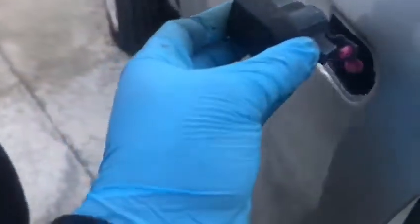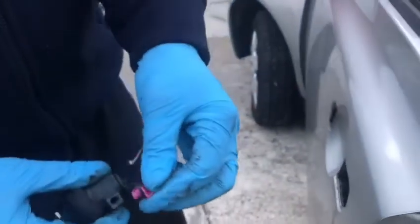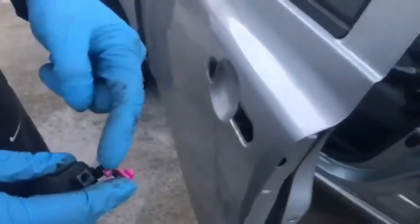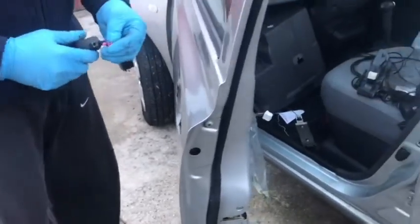So for example, this was sitting like this, clip in, and then T30 from here. You tighten that up and that holds it secure, yeah? That's correct. And you also see this plastic little pivot that goes 360 here. The metal wire that goes for the door mechanism goes into here. Oh, like the door lock? Yeah, so when you turn the key, this obviously locks and unlocks the car. Yeah, basically. Okay, fair enough.